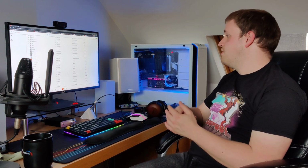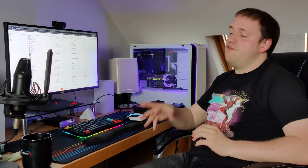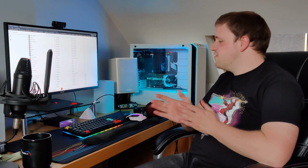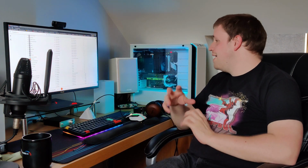One thing I will say, however, and this is something I noticed when I was previously recording, the outputs at the back will not switch off when you plug headphones in. So the rear outputs will constantly go all the time. And again, if you are using planar headphones, you will need to engage power match to get something from it, because at the 9 o'clock position on the volume dial, I could hardly hear anything through normal power through the planars. But when I engaged power match, it brought it up just right to a comfortable listening level.